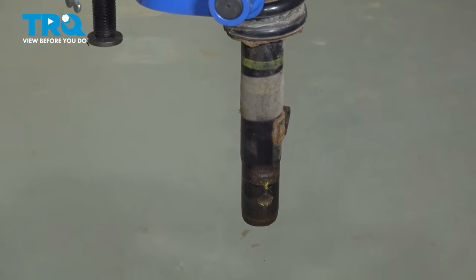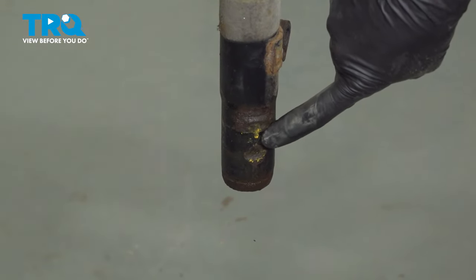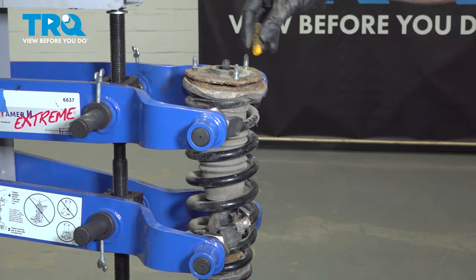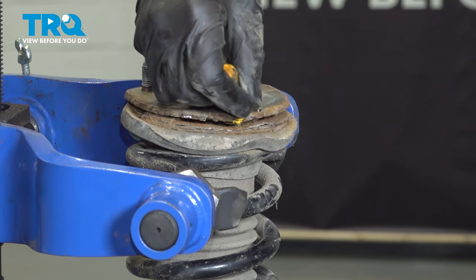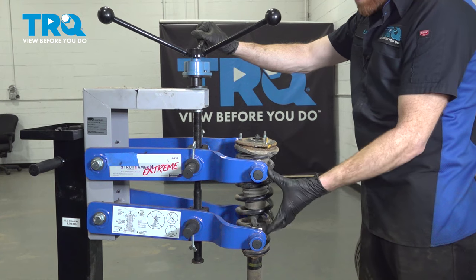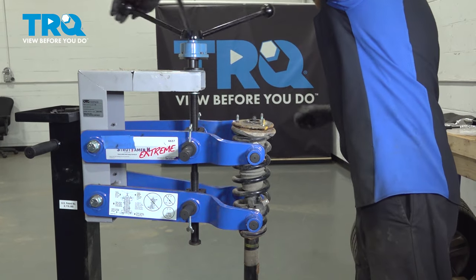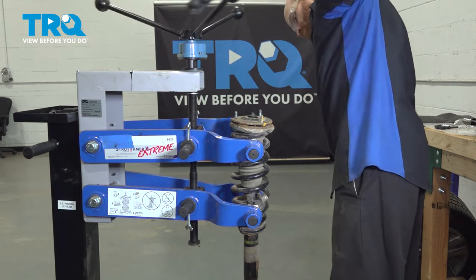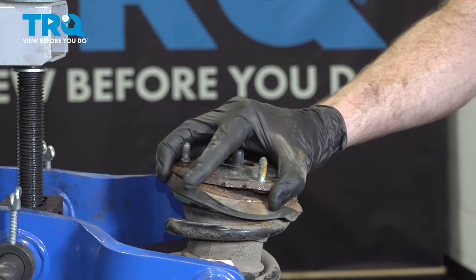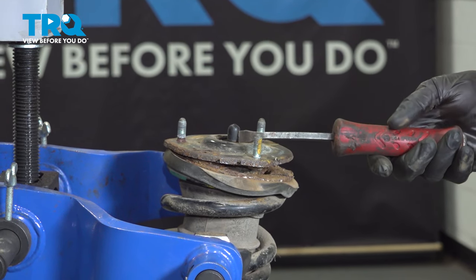We're looking for an alignment point which would technically be along the front of the strut. Now that I have this marked in yellow, if you were to follow this straight up along the strut we're going to mark along the cap as well — you'll find that it aligns right along here. Now that we've taken note of the orientation of everything, let's continue on with compressing the coil spring. You want to be as careful as possible because this will be under a lot of pressure. Once you have enough pressure on that spring that you can maneuver the cap around, we'll continue on with removing the center mounting nut.